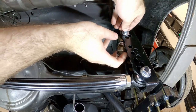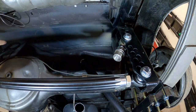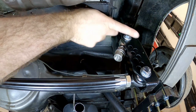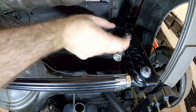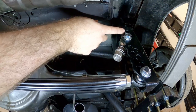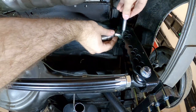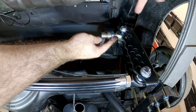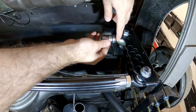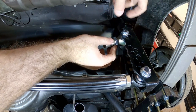For this end link, the best place is its lowest mount. The reason is it creates the best triangle for supporting this — the lower this point is relative to the bar, the stronger this piece will be. If you put it up really high you could have more stress on the system. It may be negligible, but putting it lower makes this a stronger setup without changing how the car handles. However, if you put it lower the upper bar may get in the way of your exhaust. So if you need it higher to clear the exhaust, that's a valid reason. I think I'll set this in the middle, since there's thread play on both ends for fine-tuning.